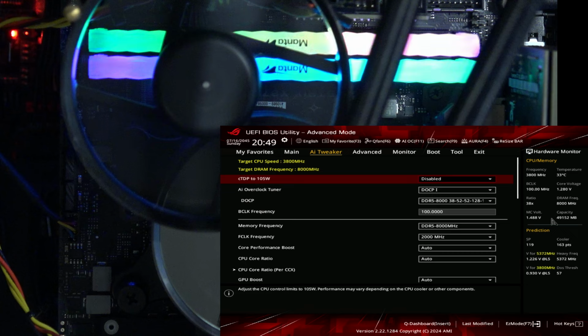Yeah. So I still think from a keeping-your-sanity perspective, 1-to-1 mode is just better. No, from peak performance, 2-to-1 mode offers more, right? Because in 2-to-1 mode, you can keep pushing further. But in 1-to-1 mode, it just works compared to 2-to-1 mode. With 2-to-1 mode, from a stability perspective, especially once you start reaching speeds this high, it's just: is your motherboard good enough? Is your CPU good enough? Are your memories, is everything good enough? Whereas 1-to-1 mode, it's just: do you have Hynix? Yes. Okay, then it'll work. Well, you do have the UCLK issue in 1-to-1 mode, right? Some CPUs in 1-to-1 will simply not work above 6200 or even 6000 if you get really unlucky.